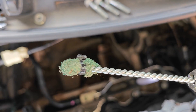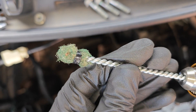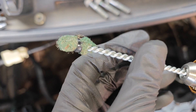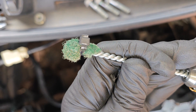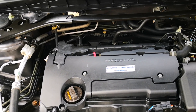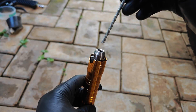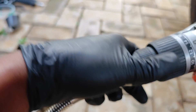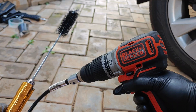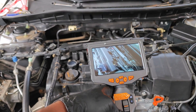In addition, I improvised by zip-tying a piece of scotch brite pad to the tip of what I cut off from the nylon brush earlier. This was just for final touches, and I'll be showing how I used it in a minute. Because the intake on this 2017 Accord faces the firewall, I also went ahead to get a flex shaft extension for the drill, but this is something you may not need depending on the orientation of your engine. For rear-facing intake manifolds, if you can, I advise you get a bore scope to help guide your cleaning efforts.